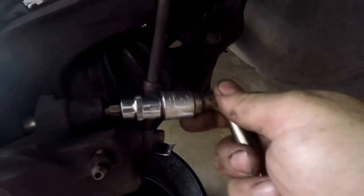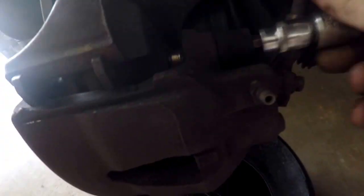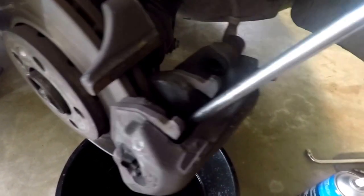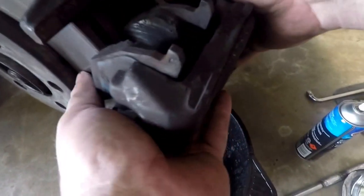In order to paint the caliper, you're going to actually need to remove it. The caliper itself sits on two caliper slide pins — they're usually a hex bit or something, sometimes a little bit different. They can be a little hard to see because they've often got a cover on them. Once you know the size, these two pins just pull out, and the caliper itself is free to move away. Mine took a little bit of persuasion — had to get a screwdriver just to peel it away. I also had an issue where the disc no longer had the screw holding it to the hub, so the disc came off as well.